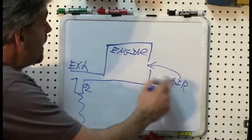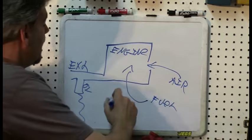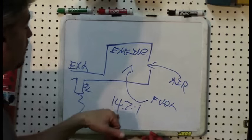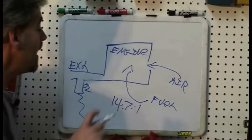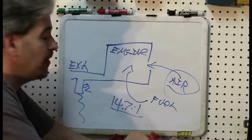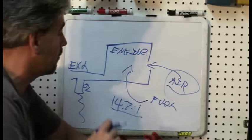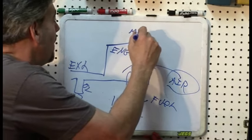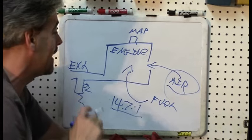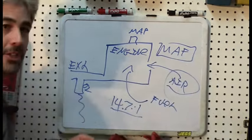The main thing is, when you get air into the engine, you of course are going to have to add fuel as well, and it's going to be in what's called a stoichiometric ratio — 14.7 to 1, that's 14.7 parts air to 1 part fuel. If the engine is going to do this, it is essential that it knows how much air is coming in. Otherwise, how can it possibly know how to make the fuel mix? There are various ways the engine does this — we talked about the MAP sensor in the previous video, and in the fuel trims and intake air temperature videos we talk about the mass airflow sensor, which also helps measure how much air is coming in.